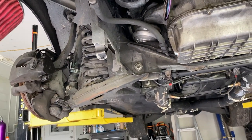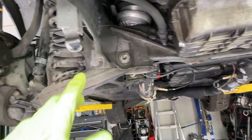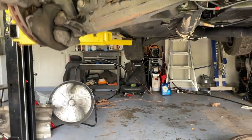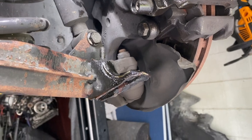Now I was recording a time lapse on it, but it was a lot of throwing and cursing because the people this guy took his car to before, I guess I had to do some work on this. Clearly they put junkyard calipers on it. So this is a little bit of a pet peeve of mine. For this one, it should be two nut bolts right there, two there, and two there. First of all, as you can see, two studs there, one's not there.